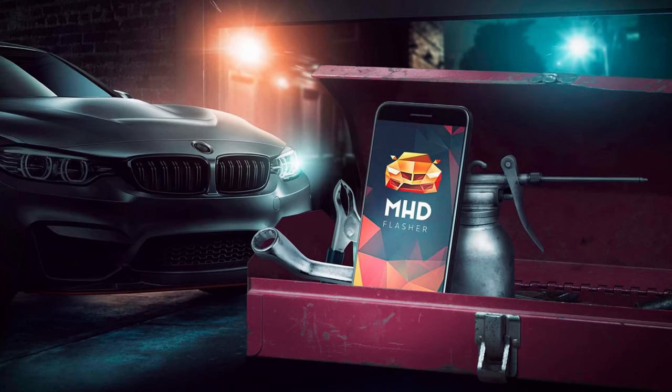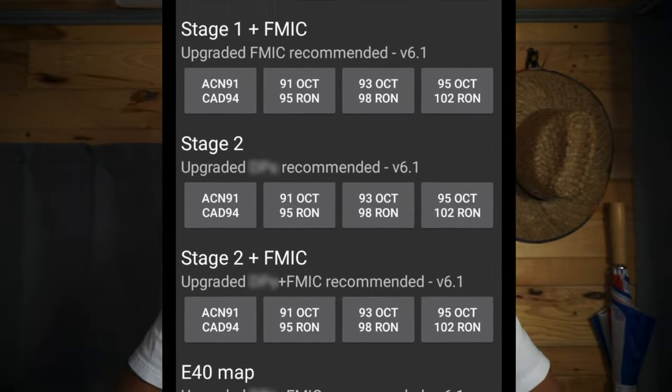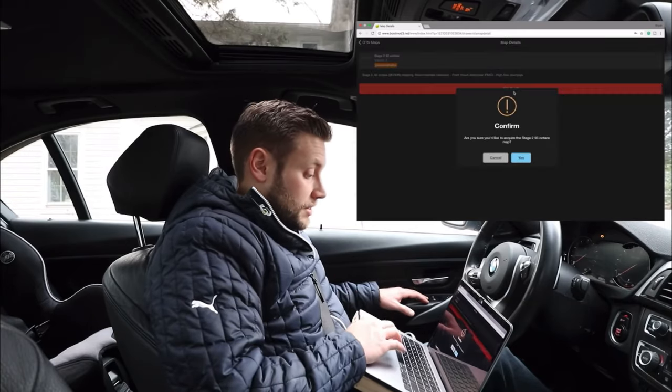Next on my list is MHD. MHD is probably the leader in making the most power on the B58 platform. You can download their app and flash your ECU with an OBD2 cable or a Wi-Fi adapter using an Android or Apple device, and they have a good selection of different maps to choose from. The third and final tune on my list is BootMod3, also known as BM3. You can choose different maps they provide, though you do need a computer or Android device for that setup. The JB4 runs around $530, BootMod3 around $600, and MHD around $440 depending on what maps you pick. With any of these tunes you should get around 70 to 80 wheel horsepower.